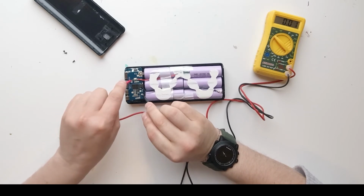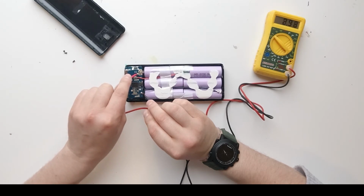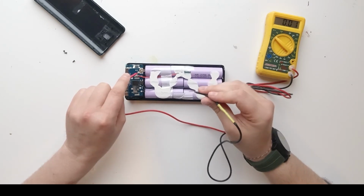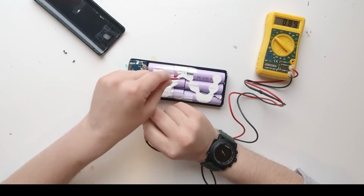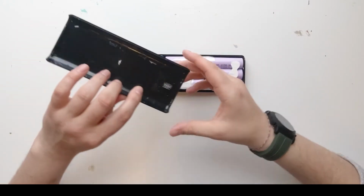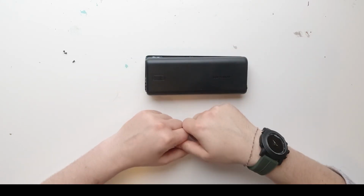And you can see it's well made. This power bank is also a good choice because the more watts it puts out, the more heat will be produced inside, and electronics hate heat, and so you don't want to go and spend your money on one that produces 60 watts. Yes, it will charge your Mac a bit quicker, but only for probably a year or something like that, and it will have an issue or it will stop working. And also that will heat the batteries up, and lithium-ion batteries, you really don't want to get them hot at all. That makes them degrade and the capacity just diminishes very quickly. You want one that can produce something a bit more reasonable, it might sound boring, but like 30 or 40 watts. And it will do that for 5 years, and your batteries will last longer without losing as much capacity.